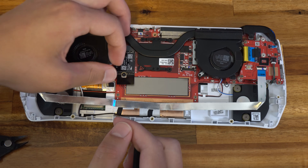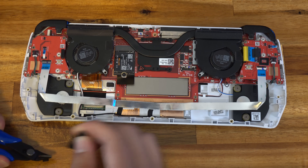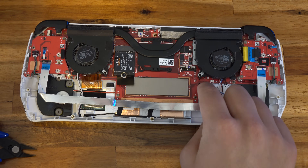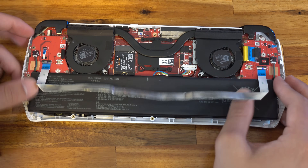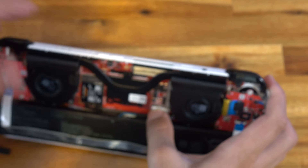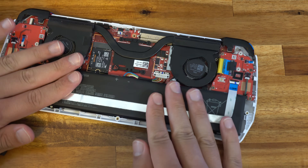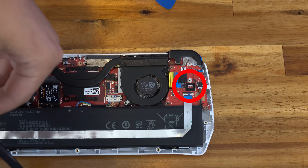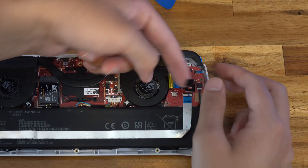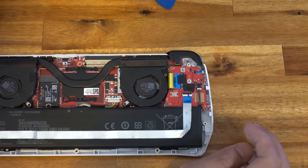Before we do the final reassembly, there are a few more things to do. Inside the battery kit there's a little stick of foam — go ahead and cut out two little squares to fit into these spots here, just a little taller than the squares themselves, so the battery has something soft to rest on top of and you don't risk puncturing it. Then go ahead and finally slide the battery back into place, pressing it down to make sure it's all flush. Take that connector and snap it down into the PCB from the top, then lock that metal clip — I found it easiest to use my fingernail. Make sure you stick that ribbon cable back onto the backside of the battery. Since we have a clear back plate, we need to cover the light sensor — cut out a piece of black electrical tape and cover that little diode on the right. Also make sure you put that black insulating tape over the SSD.